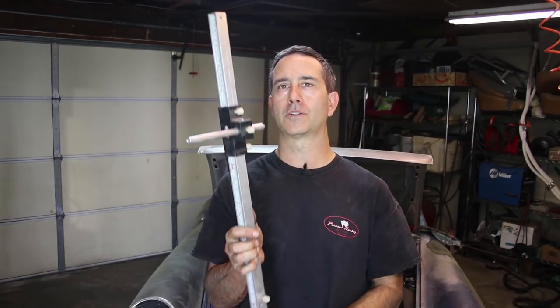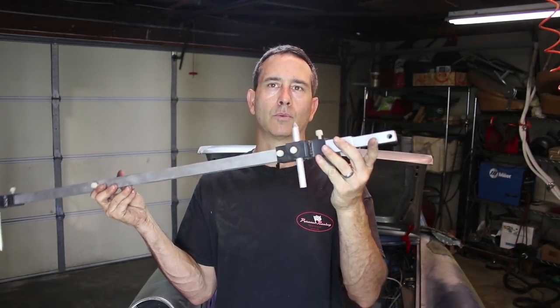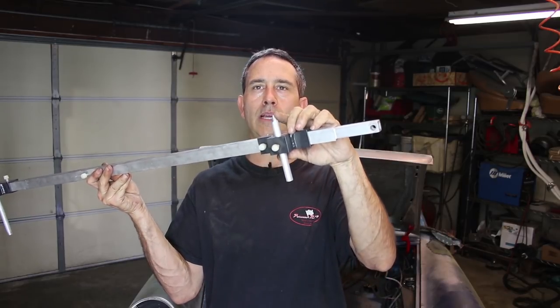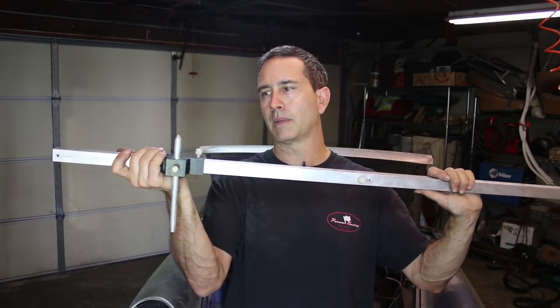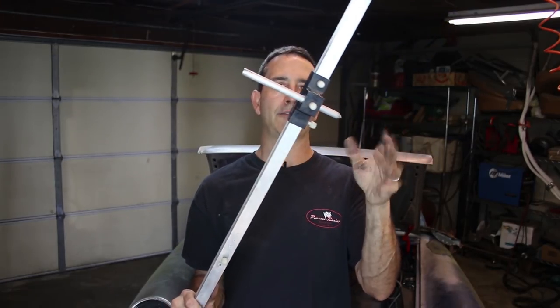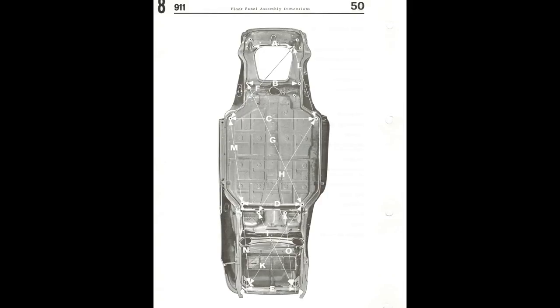Step one was to get everything planar — no twist from front to rear on all the suspension points, which I've done repeatedly to fix accident damage. Now to measure distances correctly, there's this tool called a tram gauge. It's a long aluminum piece — I'll put a link in the description. It has adjustable points that go inside a hole and measure hole-to-hole distances. It's pretty stout so you get a good, accurate measurement — a little more accurate than a tape measure, though it does have one on it. I typically compare left to right and then the diagonals — if the diagonals are identical, you know it's square. This is really helpful to check for squareness and correct suspension component placement.